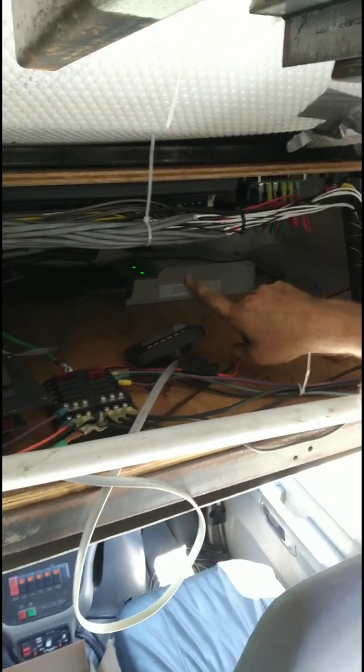When I was originally ordering the little things I needed for my solar system, I have a 40 amp charge controller, and when you want to do your overcurrent protection, you want to do 1.25 times the max current that's going to get. So for a 40 amp, you get a 50 amp fuse, and that's how you can do all the rest of your stuff. So for my 40 amp charge controller right here, I ordered a 50 amp. However, when I first ordered it, I did not have, here it is, it's a bolt-on fuse, 50 amp, 100 amp. I did not have Prime, and so it was going to take too long. It said it wasn't going to be here for like a month, and I was like, no, I need to have it before then. So I ended up buying Amazon Prime, and then I ordered 2 more 50 amps so I would have backups if that one blew.